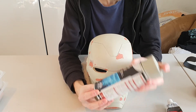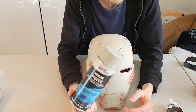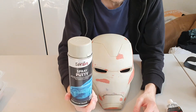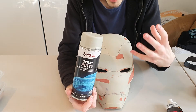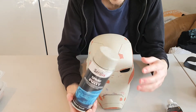Once I've done that I'll give it a quick rough up with some 240 or 400 again, and then I'll use some of this spray putty. This Simply Spray spray putty is about four pounds on Amazon - I'll leave a link in the description. This stuff is really good, it outperformed a lot of other filler primers I've seen and used. You want to do this in very thin coats - don't build it up too much because you just get blotches and it really stands out, and then you've got to sand it all down again.